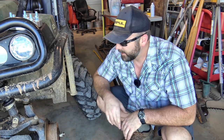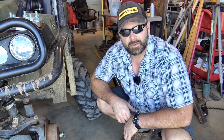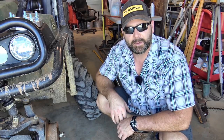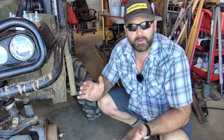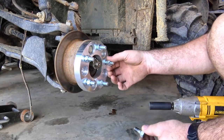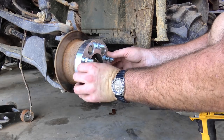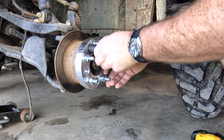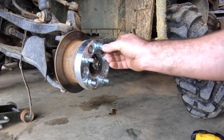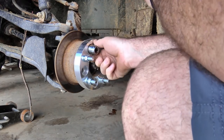The shocks have an adjustment here — I can't seem to find my adjustment tool, so I might have to search around the shop and adjust the shocks all the way out to raise it up. But let's try the first wheel first and maybe we won't have to do anything. So here's our adapter. Now we've got one of them started — let's see if our lug bolts will work here. Looks like they will, though it's a pain in the butt to get them started. We'll use this little socket. Now we're cooking — we'll just get it hand tightened on there.